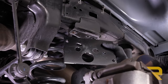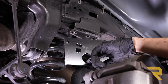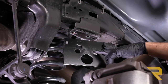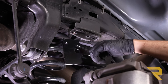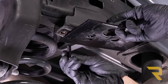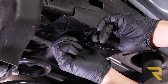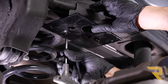Here we have our top plate bracket — make sure it's oriented properly. There's a large hole that when it mounts will be facing towards the outside of the vehicle, and two smaller holes: the one closer to the rear has an oblong hole next to it, and the one closer to the front has a small hole next to it. We'll run the new hardware through these holes up into the factory locations using large button head bolts, tightened to no more than 30 foot-pounds with a 6mm Allen wrench.